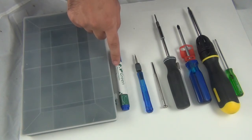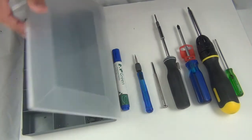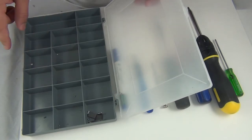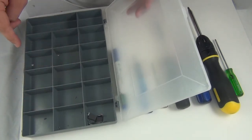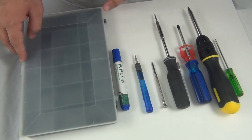If this is your first time opening up your PS3 console, best is to use a marker so that you can mark down where all the screws go — when you try to put it back together it will make the job a lot easier. Another very important handy thing to have is a small utility component storage box. The PS3 has quite a few different types of screws, so use one of these utility boxes to keep track of where all the different types of screws go.